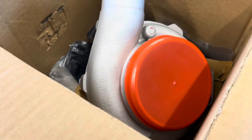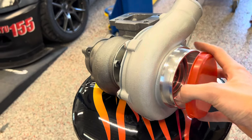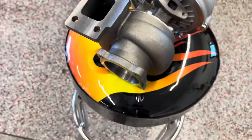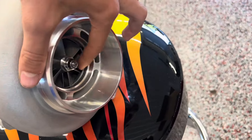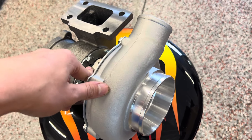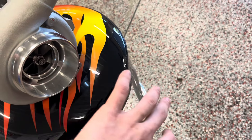Why don't we take a look at it here — it is pretty heavy. Here we go. Here we have our compressor and our turbine, with our inlet here coming from the exhaust going into here. And then all that hot air comes out and goes to the exhaust system. The shaft in here gets spun by the hot air — it's connected to this blade and goes to this one. It's a direct one-to-one shaft, so this spins the same speed as that one, and this one spins at some crazy number like 120,000 to 180,000 RPM. When this spins, this inlet here sucks in air from the intake.